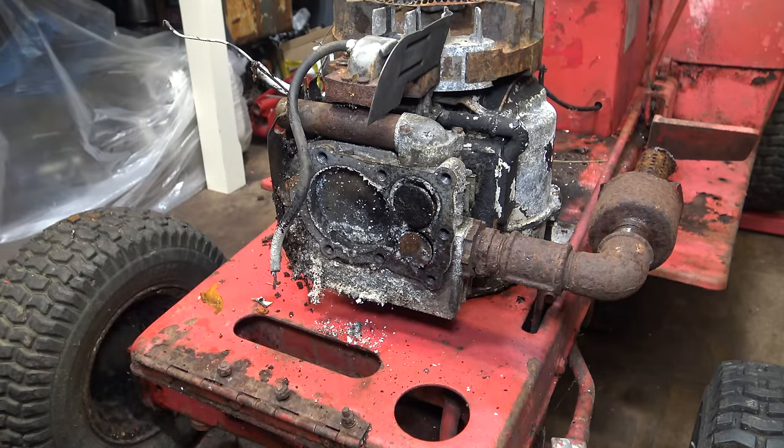These are the new parts. The grip is part number 691915, and here is the pull cord, which I've just taken off a whole spool of lawnmower pull cord. I have made the new length slightly longer since it is a smaller diameter. If I was to let go of it, I would lose it. So it's just going to give more travel when it comes to pulling the engine over, which should make it easier.